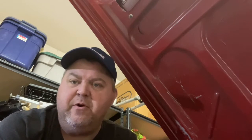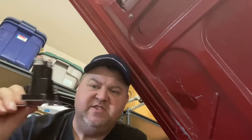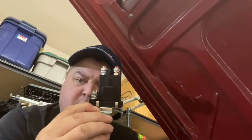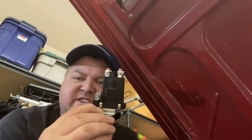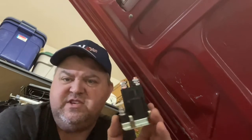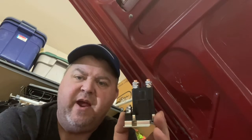One of the ways we can ensure that the auxiliary battery gets charged up when the car is running, but doesn't discharge the car's battery when the car is shut off, is by using one of these. This is basically a relay that allows power to go from the charging system circuit to the auxiliary battery when the key is in the on position. When you turn the key off, this loses its connection and the auxiliary battery is no longer connected to the main battery.